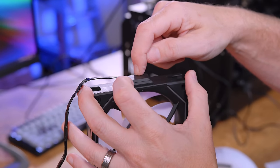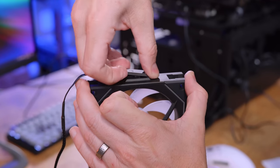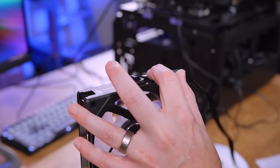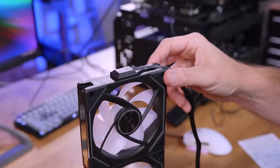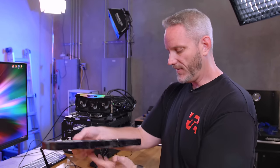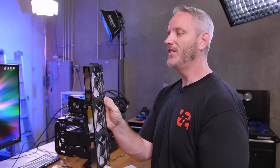The reason why the plugs are in the middle is because you can switch the cable off to the other side. You slide that forward to release it, lift it up, and it just pops out. You can flip the cable over the other way and reverse it. Now you can actually choose which side it comes out on — left or right. Trust me, the old ones forcing you to come out a certain direction really sucks when running exhaust or intake depending on fan orientation.